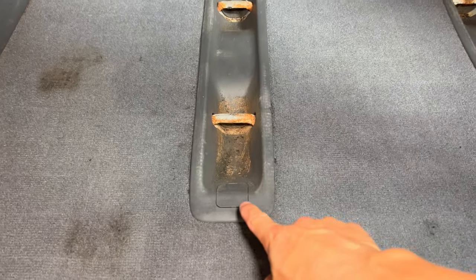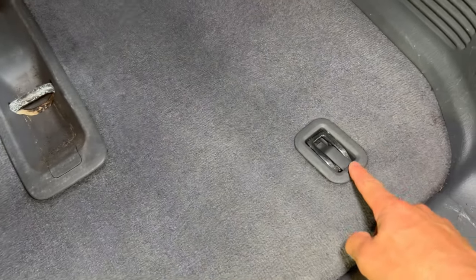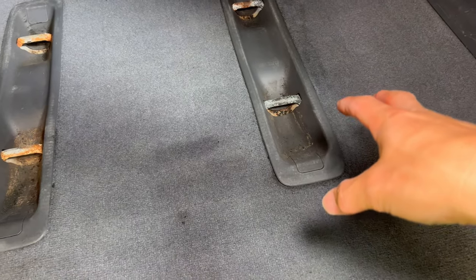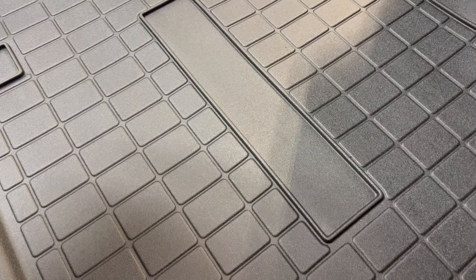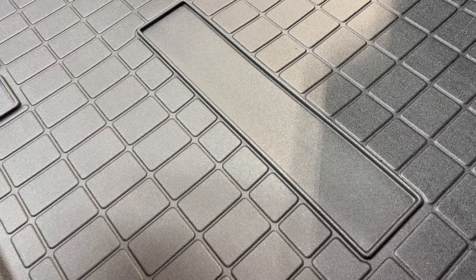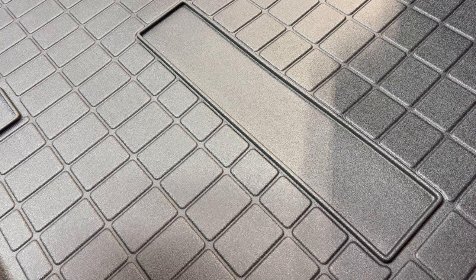Back here, we're going to have to remove the side covers — there's a screw back there that lets you unbolt them so you can take them up. You can flip these up, unbolt it, and the whole thing comes out. Once that's done, we can put the new cut floor mat in and wedge everything back in place. We'll use a razor blade to cut it, but first I want to take those covers out to make sure we're cutting enough — about a quarter inch of gap or clearance so everything covers up with no gap.